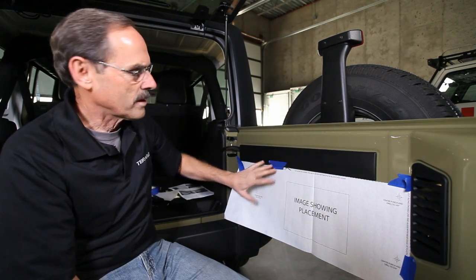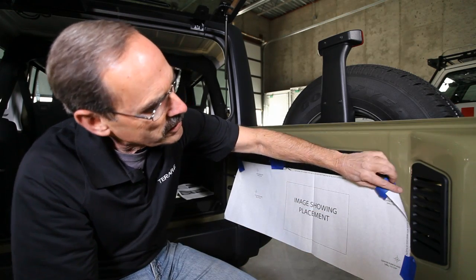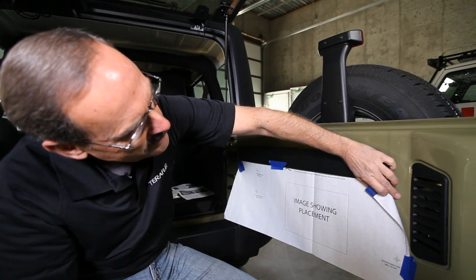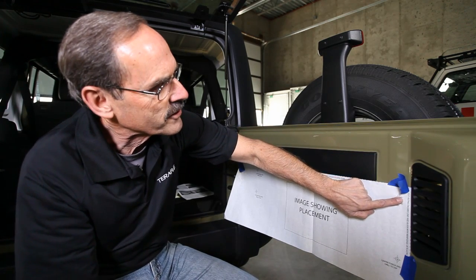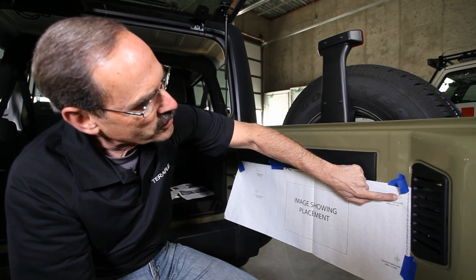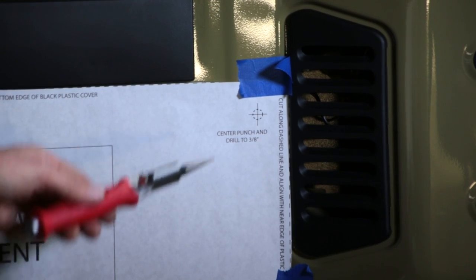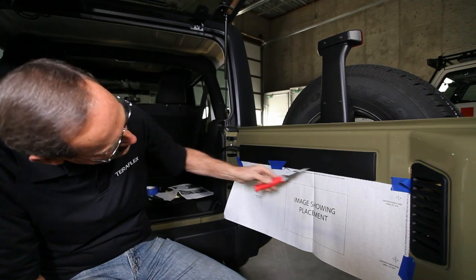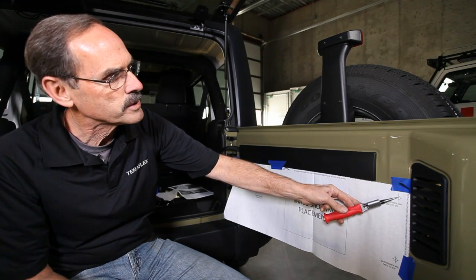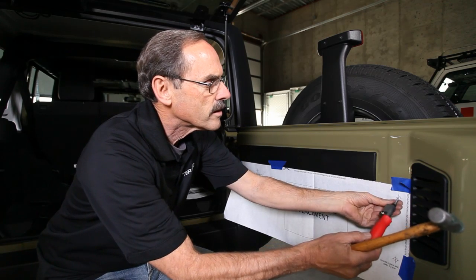Make sure it's pushed clear up against the plastic. The problem is all the other holes line up pretty good, but this top one is really close to a rivet. So we want to make sure our hole is close to the edge of that rivet and tucked clear up against there. Grab your center punch and mark these holes — double check your edges are all good and everything's in position, then center punch and get ready to drill.